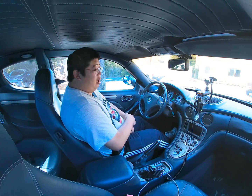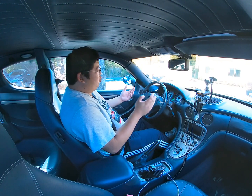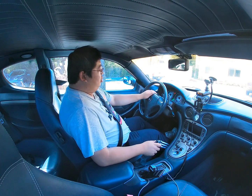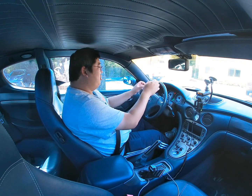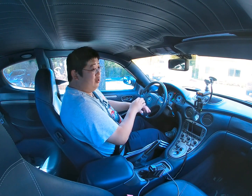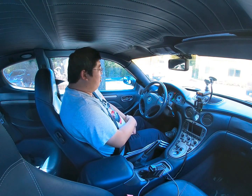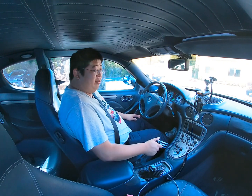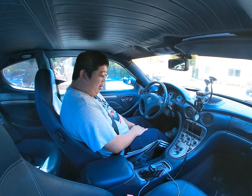With that, we're just going to warm up the car a little bit and demonstrate how to drive in different modes inside the city. Right now the car is in neutral — I pulled both paddles back to shift the car to neutral — because you cannot start the car in first gear, and the car does not have a parking gear either. You want the car to be in neutral before you start it, and always have the handbrake on if you are not moving.